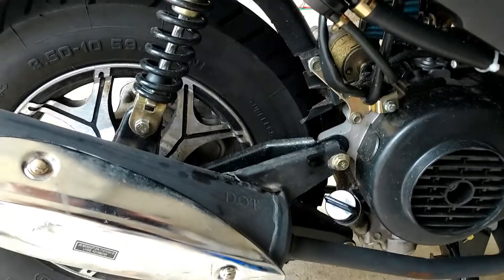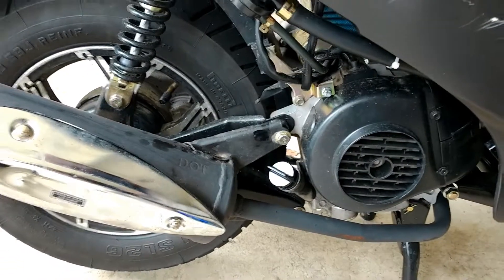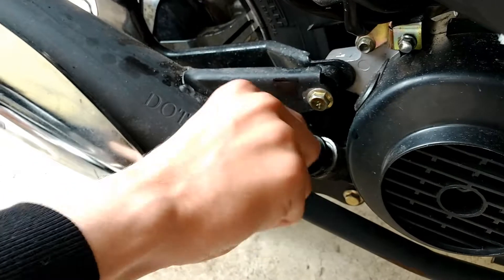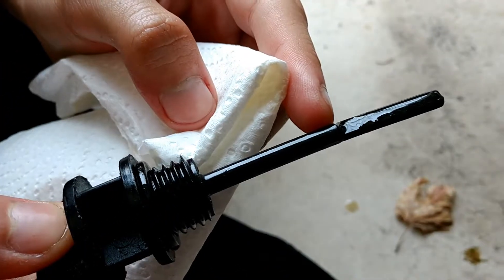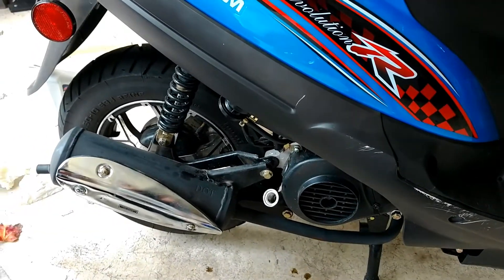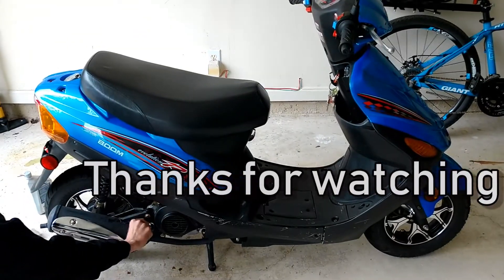The scooter is now running and the oil has heated up. Let's stop it and check the oil again. First wipe the dipstick, of course. With the scooter level, put it all the way in and pull it out. It's about perfect. Well changed! It took just a little bit less than one quart. I'll check it again in a day or so after you've ridden around. That's changing the oil on a Boom 50cc scooter. Thanks for watching!